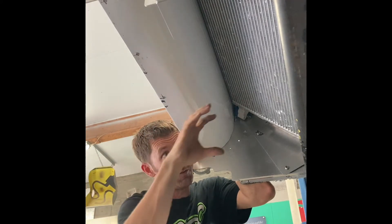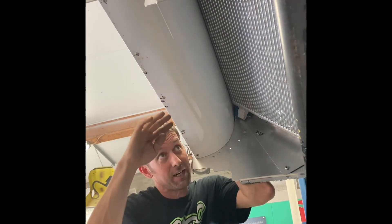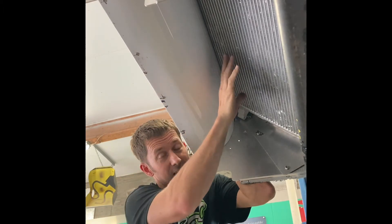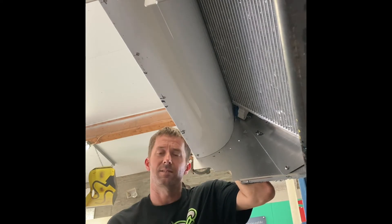What that does — you have air coming through, but then it gets dispersed directly into the radiator and following the curvature. So now we can fill this whole radiator full of cool air in order to get the cooling system to work sufficiently, get the engine temps down so this car can do well on a race track.